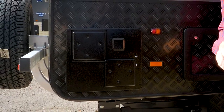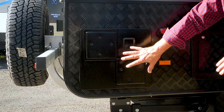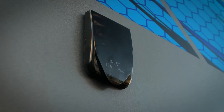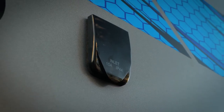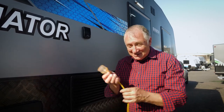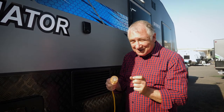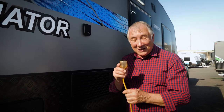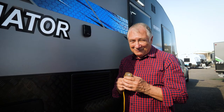This is your hot water heater — don't touch that when it's hot! Now here's another Paravans handy hint. Your power inlet is 15 amp. Your normal domestic power is 10 amp, so you can't use your domestic cord. This is a 15-amp cord — you'll see the third pin is much bigger. Don't try to use your domestic 10-amp on a 15-amp. You need to go and buy a proper 15-amp lead, available from any caravan parts supplier.